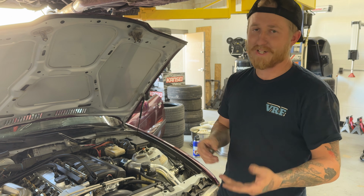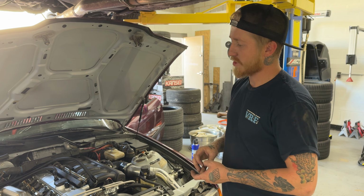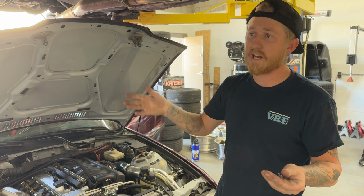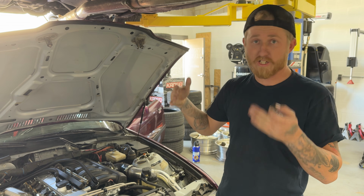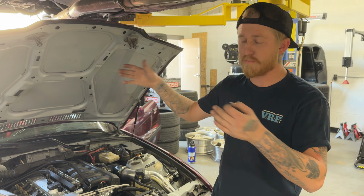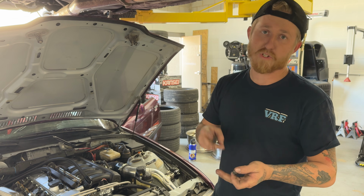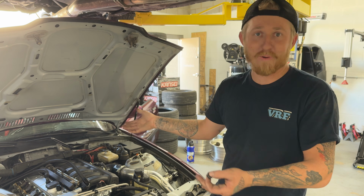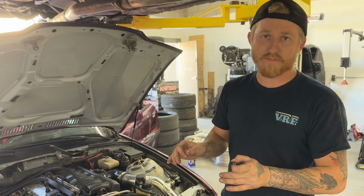So assuming Mike and I are both correct in our assumption, we can throw some screenshots up to show you. The Mac valve goes on to basically pin 1 or 2, which is like a high input, something like that. And then your wideband is going to go to your EGO pin, which is labeled, but the ground, the negative, we believe goes to sensor return, which will be pin 20. We'll find out here in a few minutes when we load up the ECU, but assuming that's all correct, make note of that because there's not a lot of info on that on the internet.